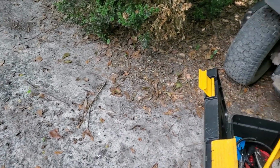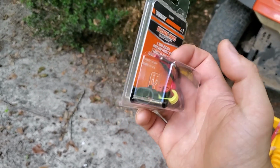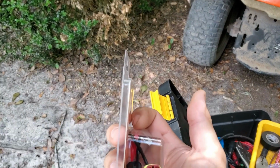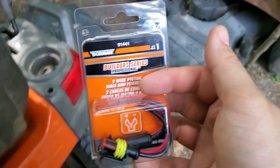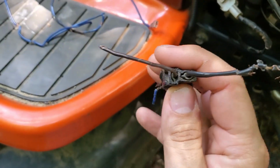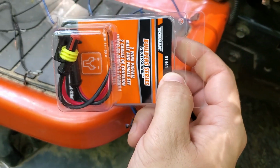The wiring I did for my LED lights on the front of my truck, I use these, and then when I cut out the factory fog lights to wire in more LEDs, I use these. So I'm just gonna use one, and I know this one has 3 and then out to 2, but you can kind of see it in this little plug. They put 2 into 1 and then that 1 into 1. So I'm just going to do the same thing. I'm going to take butt connectors, 2 to the negative, 1 to the positive, and then out the other side. I'm just going to do 1 and 1 because that's what they did.